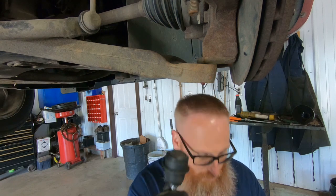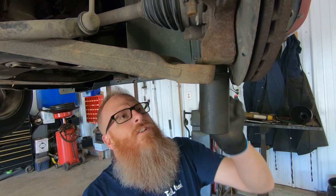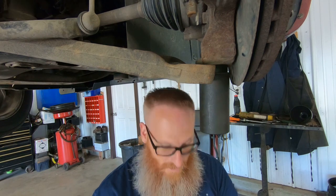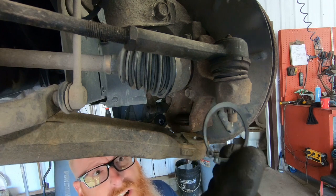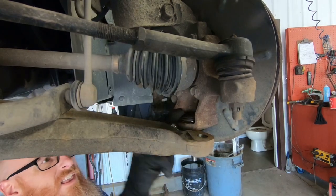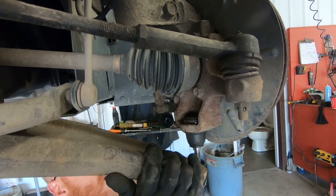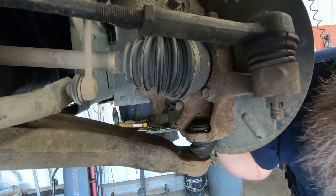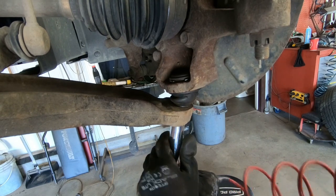There's the new one. We just got to get it pressed back into place the same way we took out the other one. The trouble I'm having is I don't have the adapter to fit up top here, so I'm going to end up taking the old hammer and bumping her into place. Now that we've got the ball joint pressed in, we've got to take our retainer clip with the snap ring pliers and get it poked in there. There we go. Now that that's in, we can start putting it back together — grab our new nut, cram it on there, and we'll be ready to rock and roll.